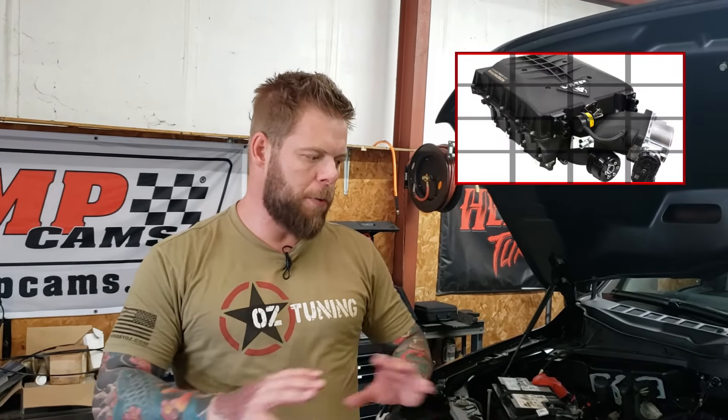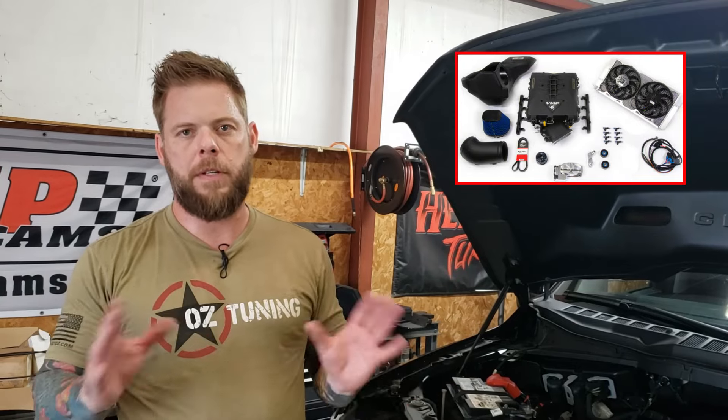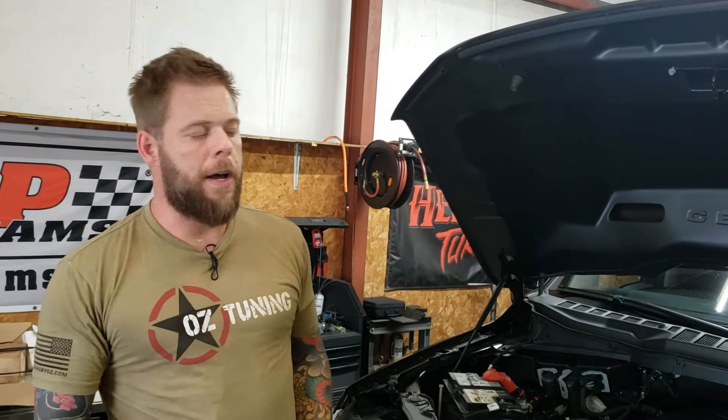The kit itself is a complete Odin kit — heat exchangers, the whole nine yards, the big intake, the twin 69mm throttle body — the same Odin base kit that comes for the 2018-2020 and 2015-2017 F-150s. The major difference is going to be in the pulley selection. We're going with a standard 88mm pulley for both 93 and 91 octane, and additionally for E85. One cool feature about Odin kits is they already include a fuel pump booster — VMP makes their own fuel pump boosters and includes it in the kit, so you instantly have much more fuel flow than with a stock fuel pump.